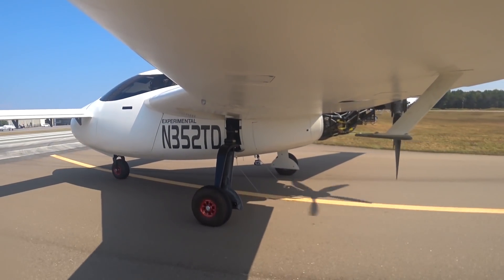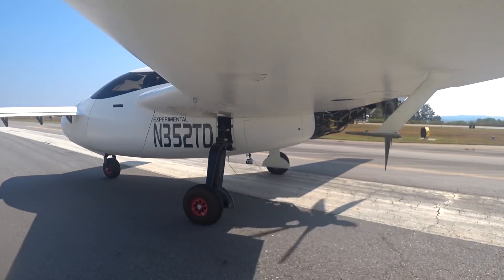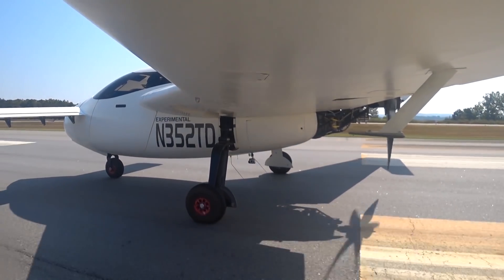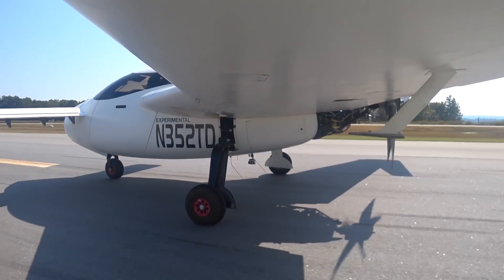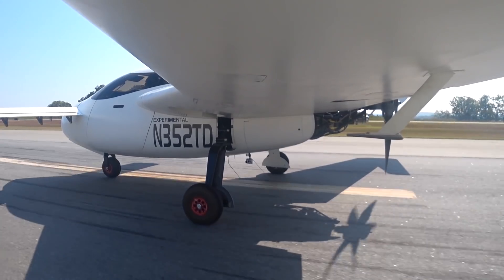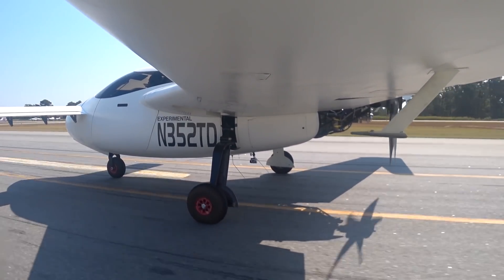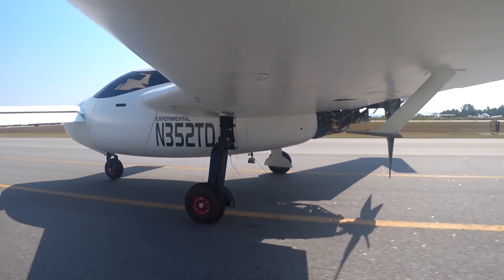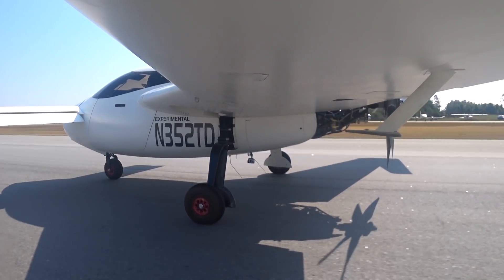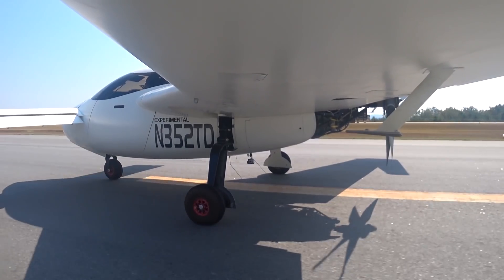On Tuesday, although I really wanted to do more tuning, I also wanted to do some taxi testing and see if the nose shimmy problem had returned — which I fully expected, since this is basically back to where I was before with a clean set of oil in the strut. This is the last run I did for the day. I did about four different runs down the runway at varying speeds, and this is the quickest one. This is also with the old tuning setup, so you can see the smoke coming out the back — that's going to be fixed soon enough. I did get the nose off right there briefly, so that's the second time doing that. At about 65 miles an hour the nose is just almost perfectly balanced when you pull full elevator.